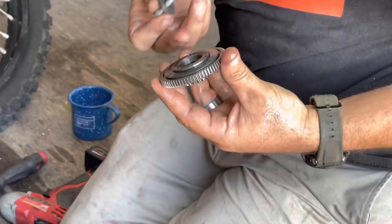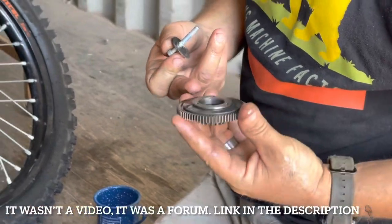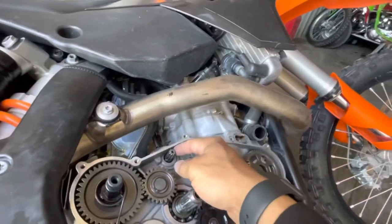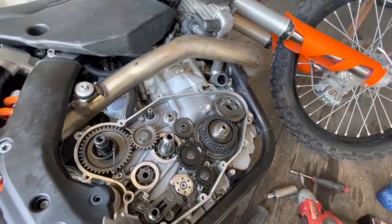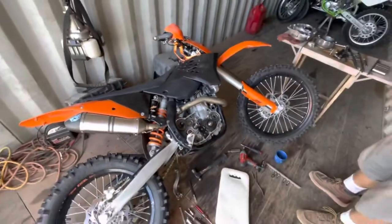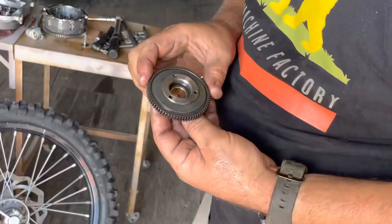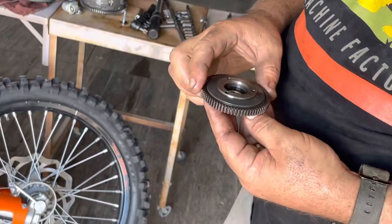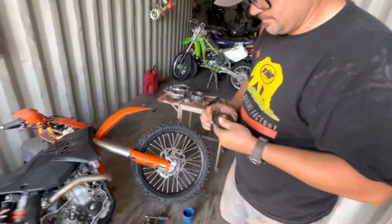So nut washer. Now, this is what they tightened, right? You remember the video we watched? Yeah, because this is the actual clutch mechanism. Yeah, they put it on the vise. Yep. And so what we think is going on is the starter is spinning it, and the torque limiter is just kind of spinning out without actually turning the engine over. Yeah, and probably when it's on nice easy compression, that's when it does turn it over. So it's not completely useless, but pretty useless. But I think they're thinking if they made this solid and it ever kicked back, it could break a gear. Right, because it does spin freely backwards. When I took the starter out, I can get a flathead in there and turn it backwards just fine.